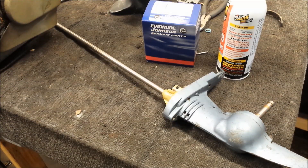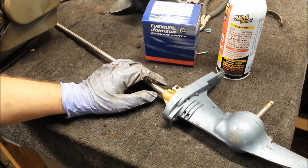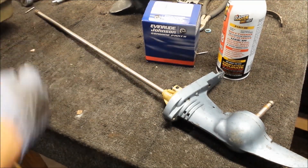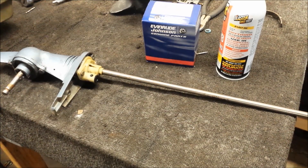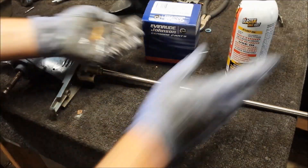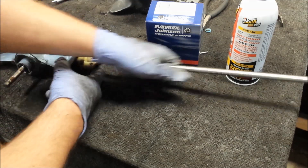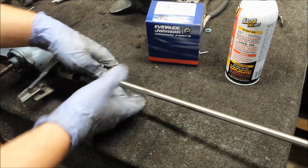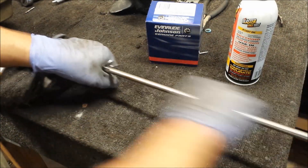I got my shipment for the parts that I need for my four horsepower. What I'm going to be doing now is a water pump. I started making a video a second ago and realized I didn't hit record, so you're not going to see a lot of it. But what I do first is I clean up the drive shaft — I spray some PB Blaster or WD-40 into my glove and then use my glove to go up and down the shaft. That will loosen all the carbon buildup and deposits. That's the first step I do.